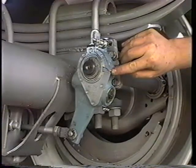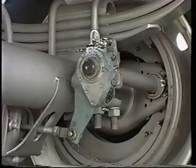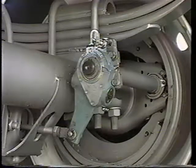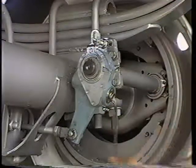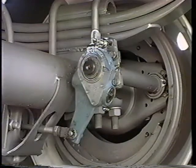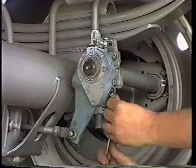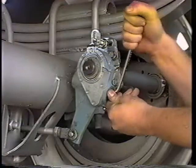Then, check the indicator again. Now, let's do the brake adjustment. First, turn the 7/16ths adjusting hex clockwise until the lining contacts the drum. Next, back off the adjusting hex counterclockwise approximately half a turn. You'll hear that perfectly normal ratcheting sound. And that concludes our typical installation on a trailer.